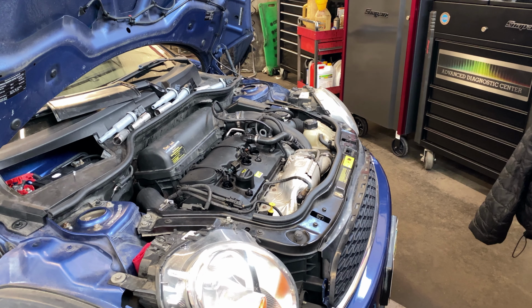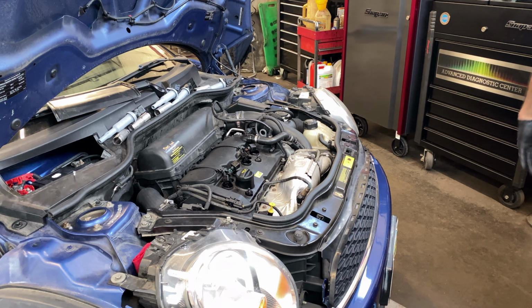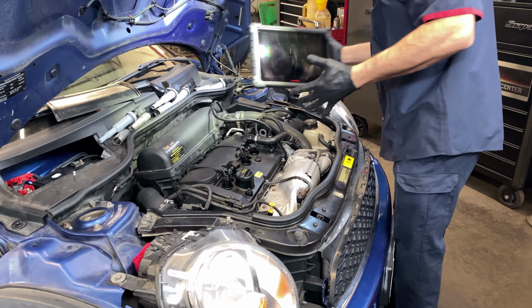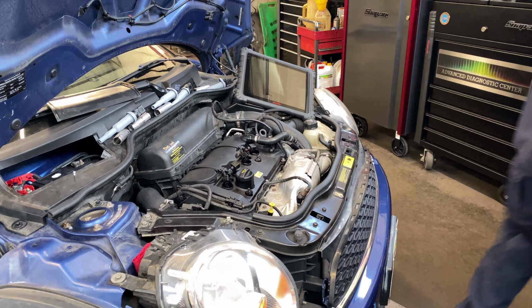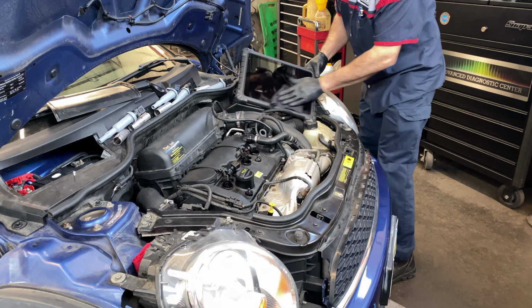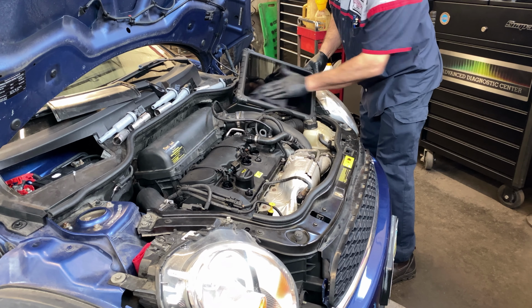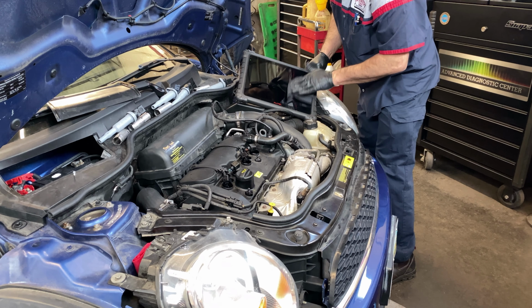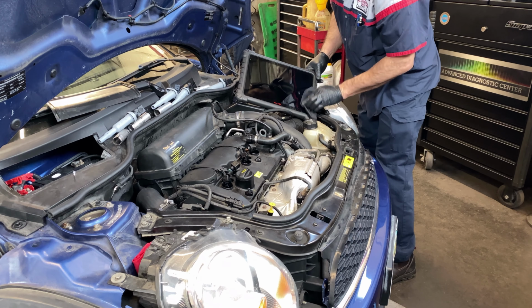Hey guys, I want to revisit that borescope now that the engine is a little cooler. I know that I'm losing compression on the cylinder, but I'm also hearing exhaust. And looking at that crack, it seems to be a cracked cylinder head. It doesn't please me too much yet, so I want to make sure I'm giving this person the correct diagnostics, and that's what he's here for.